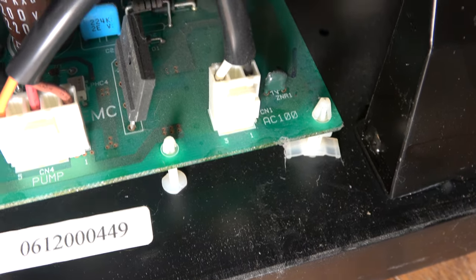But is that good? Because this is only a tiny little diode. It couldn't dump the 1 amp that can come from this regulator. Well, the failure mode for these is they go short circuit, like it has. So if this started dumping loads of current, it would go short circuit and protect the rest of the board. That might imply, then, that our regulator has failed, but I've measured it and it's absolutely fine.